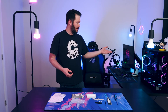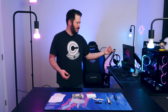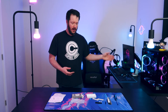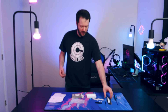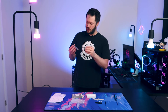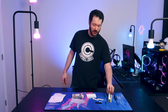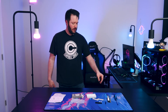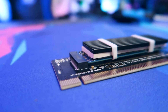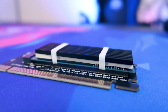Where would this come in handy? In my case, I have a B550 Aorus Pro as my main motherboard — it only has two M.2 slots, one Gen 4 connected straight to the CPU and one below that to the chipset which is Gen 3. This adapter only works for Gen 3, but that's fine because the Kingston drive I have is just Gen 3. So if you're out of M.2 slots and want to add Gen 3 storage, this is a pretty good way to do that.